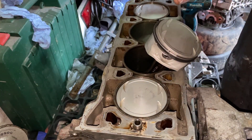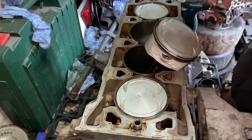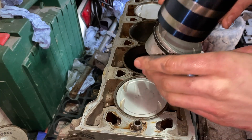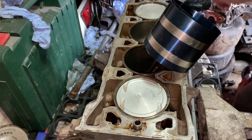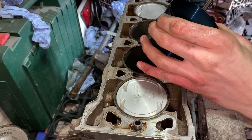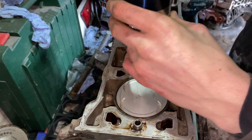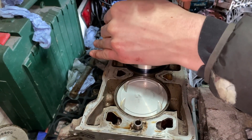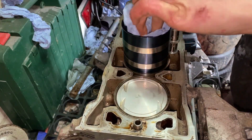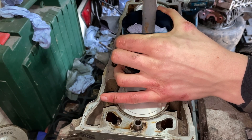I've put three of the pistons back in. I'll show you quickly how to put them back. All the arrows have to be facing the same direction as when you removed the piston — all of mine are facing towards the cam belt end of the engine. You need one of these piston ring clamp tools. Bring it over the piston and in my case it's a little wrench that you tighten over the piston rings. Ideally you want to seat it ever so slightly in the block. Keep pressure down, push down on the cap to keep the rings from popping out. Once it's tight, put a bit of tissue in there to protect the top of the piston, then push down hard on the piston ring tool and just tap the piston in.